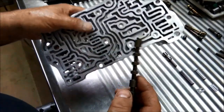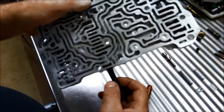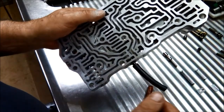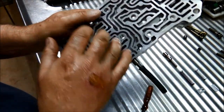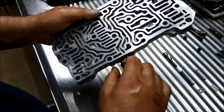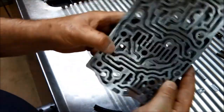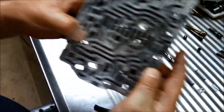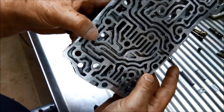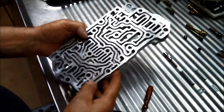Now I've just cleaned and blown it out and worked it through with the solvent. I did actually notice there were quite fine little aluminium flecks coming out still, so they were obviously stuck in that bore there. So I've just worked that through like that, and you can see it's just shuttling quite nice and easy now. Alright, we can put that one back together.